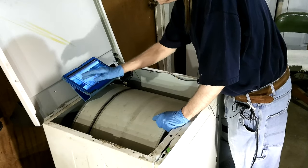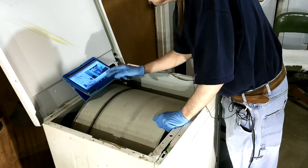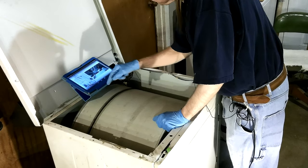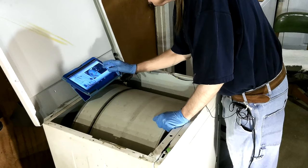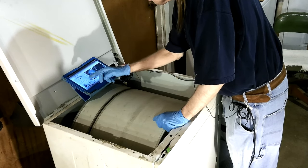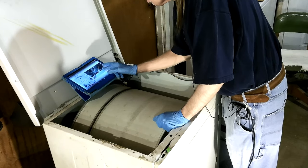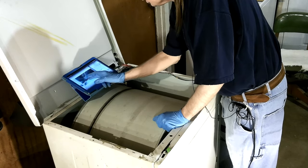And I do remember, well, it's 15 ohms. Let me make sure, though. Ohmmeter. Somewhere I should have got a screenshot. Okay, yeah, disconnect it from the timer and then get on the red one, the one that's going down here. Hopefully that red one is the one that goes down here. If I don't get anything, then I guess I'll know. That shows it with it plugged in. Guess we could try it both ways. Try it with it plugged in and then I'll unplug it, all the way to the heating element both times.